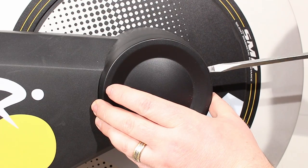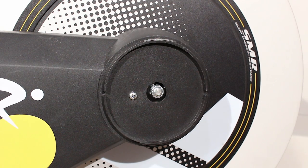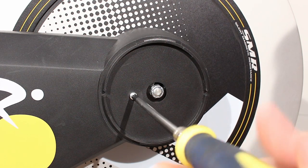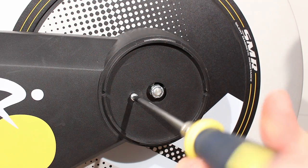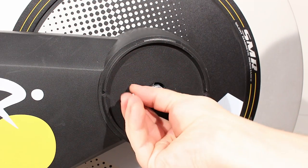Use your flathead screwdriver to pry off the shield covers from the rear of the side shields. Then use a Phillips head screwdriver and remove the side shield screw under the cover. Also remove the shield cover and screw from the opposite side of the machine. The right side shield must be removed first.